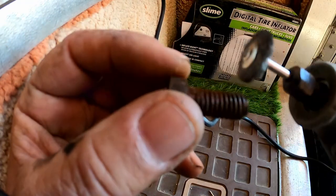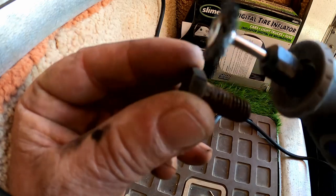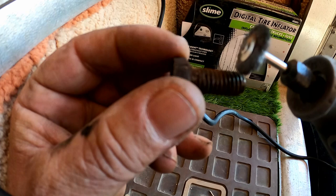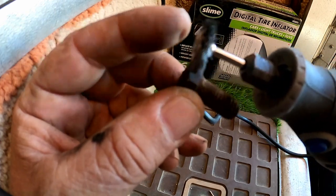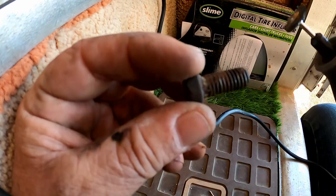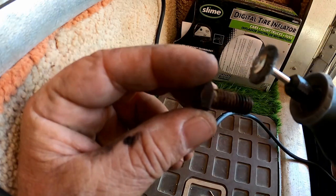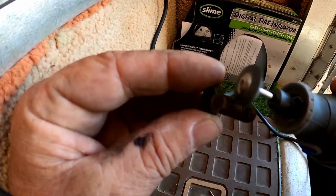Actually, these are 3/8-16. If I get them half clogged, half cleaned out, and then I find a good 3/8-16 bolt, which I think I have, I can hold this in with a wrench or socket and run that nut on and off of these. That'll finish cleaning those valleys out. Oh, there's always a hack. There's always a tip, a trick. There's always a way.